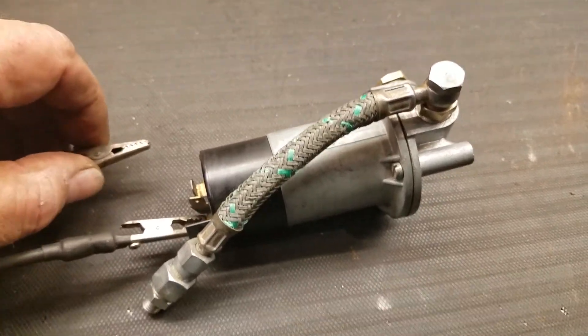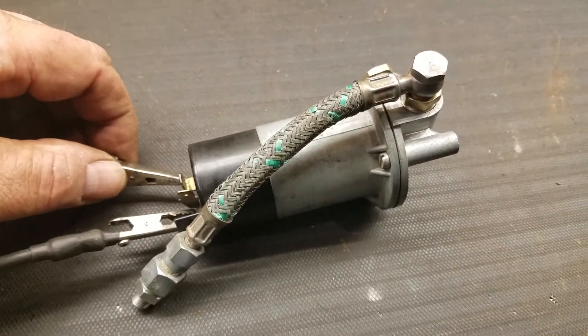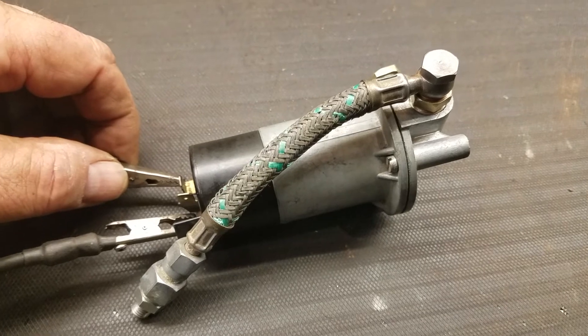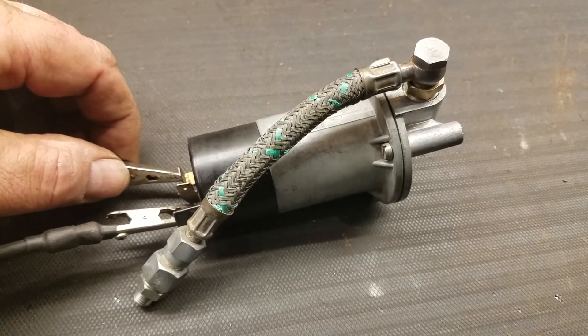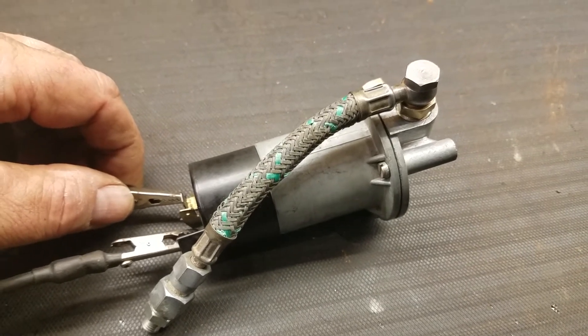Here's another pump that's been pulled apart and cleaned. The diaphragm in it is supple and pliable. This one is basically all original, like the last one. And as you can see, it works great. Points have been cleaned.